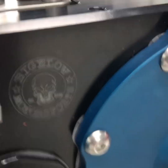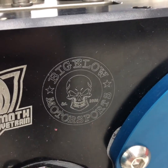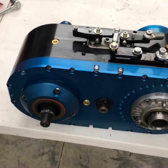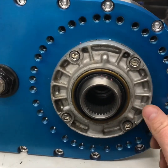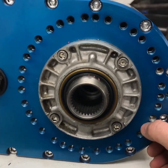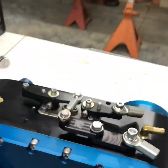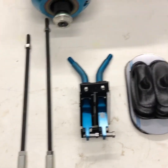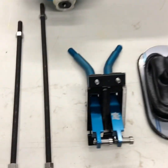Just noticed this laser etching on the back of the transfer case — really cool. You've got your shifters up top, front dig, all that cool stuff. I opted to go with the 2:1 ratio — 196:1 crawl ratio — going to be running 14:10s. Went with the upgraded outputs on both ends, standard 32-spline on the input. A million-to-one different clocking options so you can get it nice and flat. We'll be able to get it into the chassis no problem, behind a Turbo 400.